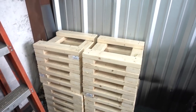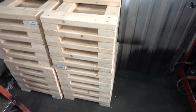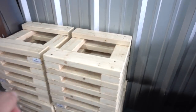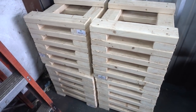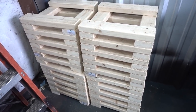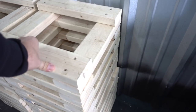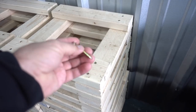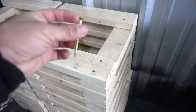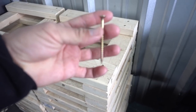These are the finished stands. All you're going to need for this project is 14 2x4s that are 8 foot long, if you want to do the same setup. These are 15 inches high, which should give you enough clearance to pull the transmission out. Make sure you get some nice ones that aren't all bowed up, and you want to buy five pounds of screws — two and a half inches. Screws seem to be a little bit stronger and hold better.